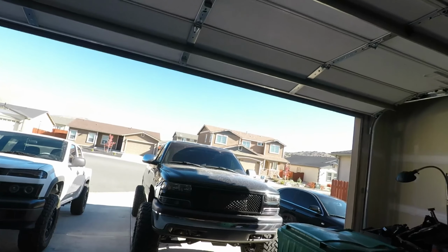I just took it around the block. It runs like it should, or I guess like it used to. The only thing I can figure is that either I messed up the gap on one of the old spark plugs when I re-gapped it, or maybe just one of the spark plug wires just wasn't plugged in well enough, because I took it around the block, didn't misfire at all, and got on it, and it ran good, so whatever.